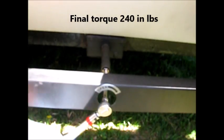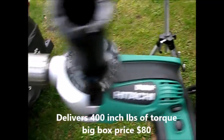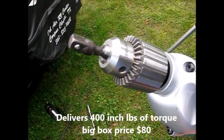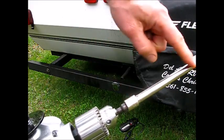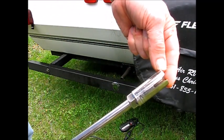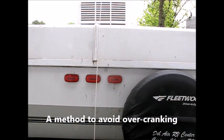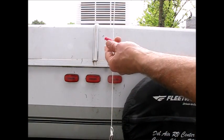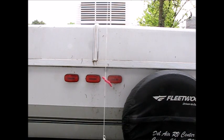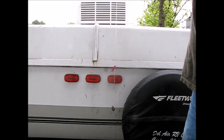We're just going to keep raising it, increase a little bit to 140. So we've outfitted this 9-amp corded drill. We've got a chuck in here — in the chuck we have a square drive, 3/8ths inch. So let's put our tooling in here. We've got a 6-inch 3/8ths inch extension, and my specially made socket to match the slots. I've come up with a simple means to tell when the camper is nearly all the way up — a clothespin and string. When this little piece of thread gets up to the top of the box, we're almost all the way up and I can stop my drill.